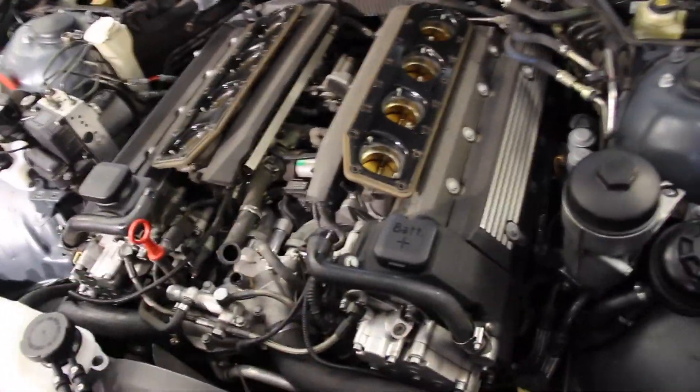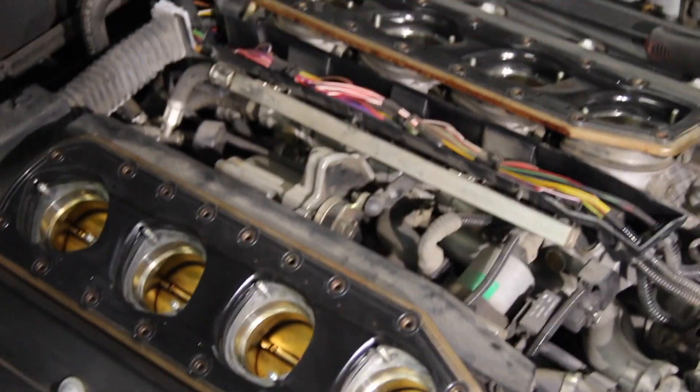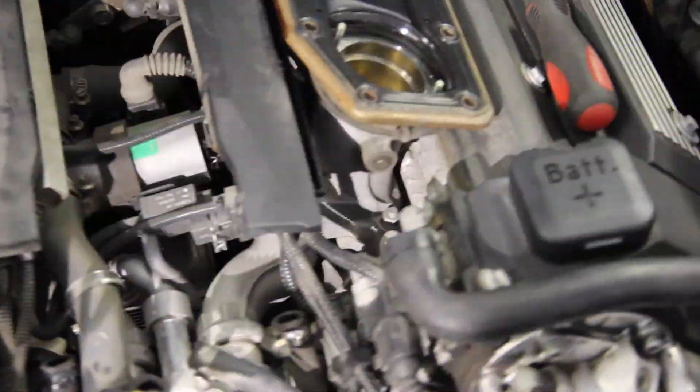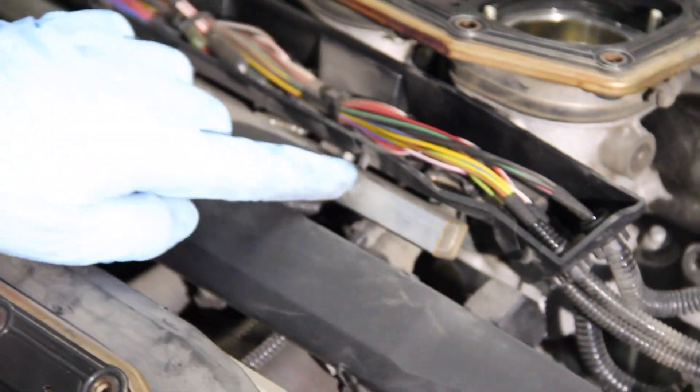We now have a beautiful view of the inside of the valley and the throttle bodies themselves. I also disconnected the coolant temperature sensor electrical connector, which just pulled straight off — that gave a little more room to work on those hoses. Next up are these two plastic black conduit cable runs that hold a lot of the engine harness and wiring. We need to remove the one on the driver's side — at least for a USA car — and it's held on with a series of very annoying little clips that require a flathead screwdriver or pry tool to pull the tabs away.